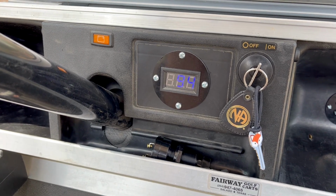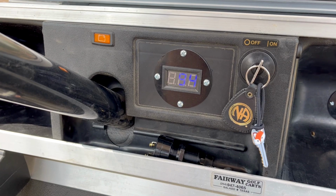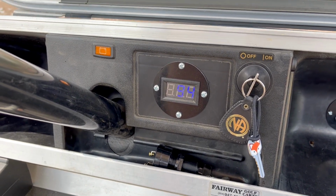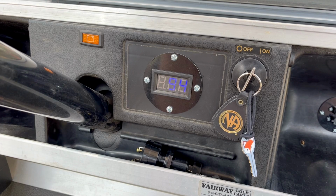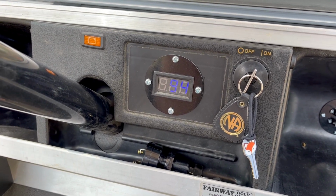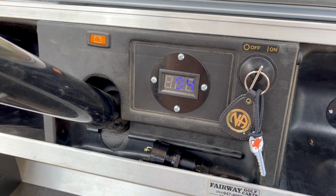So if you're driving around at night, you're going to be annoyed by the blue glare, and in the daytime, you can't see it. So I dislike that a lot. I also don't like that it only measures the voltage at the main bus bar, which means that it is interpolating or extrapolating the actual charge the batteries have. And it jumps all over the place.